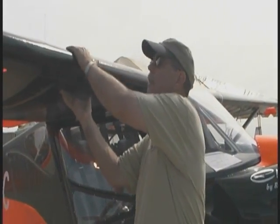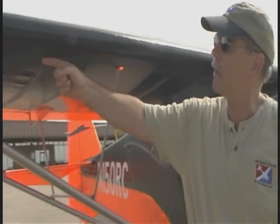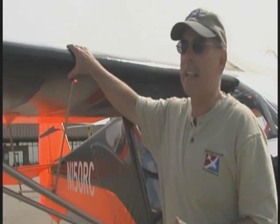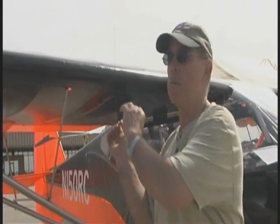This wing covering, there are people who come out of the GA world used to metal, composite, and whatnot, and go, what is this stuff? This is like fabric, only it's not doped fabric like a Cub uses. It's sewn fabric. You can see the stitching on it in various places. They both use the same kind of covering on it. This stuff is actually extremely tough, holds up well, especially as they can put a coating on it to help with UV resistance. But even after a few years, if you have to replace them, well, they slip off. Well, not quite as simple as that. They take a little bit of doing, but you can replace the whole wing covers, the whole fuselage covers, and you're back in business again.